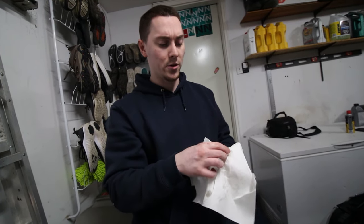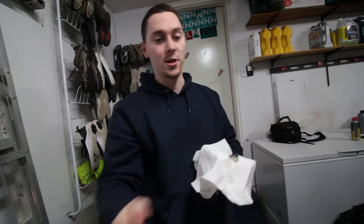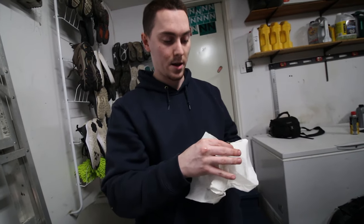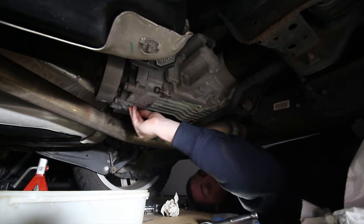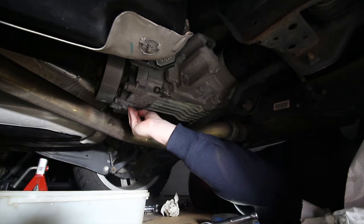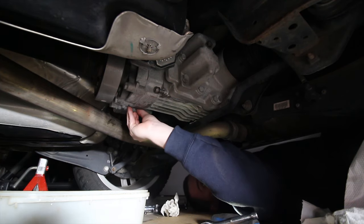The other footage will show how much more of this sludge was built up inside the pump housing. We're just going to clean that out and then jump back underneath the car and start filling it up again — pretty impressive stuff. The pump is back in after we cleaned the screen and the inside of the housing. Today I will not be changing the Haldex filter as I could not get one — Volkswagen is a bit of a gong show right now, and the filter is literally probably the most expensive part of this entire service.